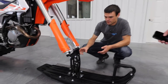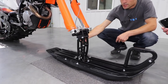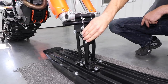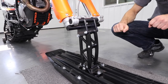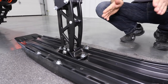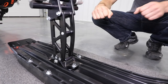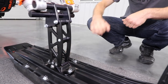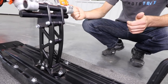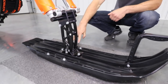The front end isn't changed as dramatically as the rear, but there are definitely some things to note. One thing is these braces right here — last year there were no braces in between. With the bracing, it makes the ski frame a lot more rigid since there are only two blades here, and it provides more precise steering overall. On the base, you'll see a huge difference. Last year we had a stainless steel bent mount that was okay, but it had a lot of side to side and twisting flex. There's a lot of torsion on those two bolts, and over time that mount could wear and bend. It was also susceptible to damage easily if you hit a stump — under the snow it could bend back. It was a design fail point and just too loose in general.